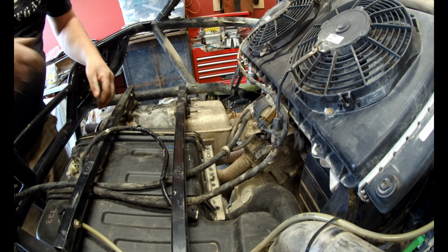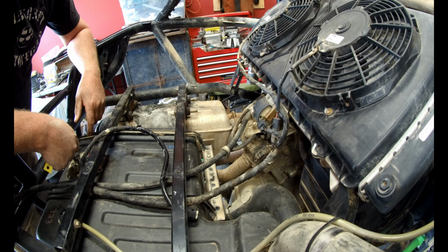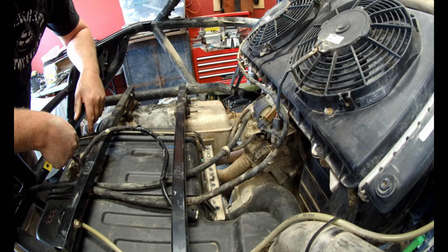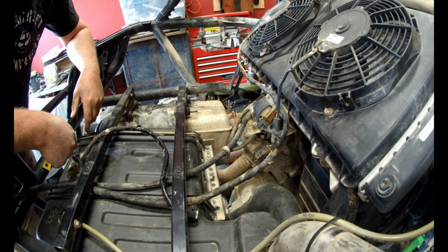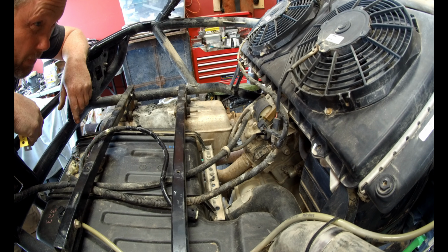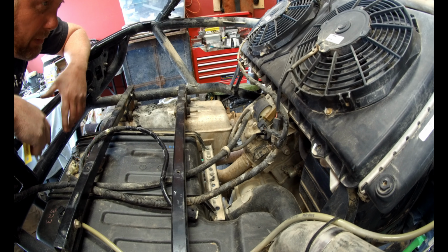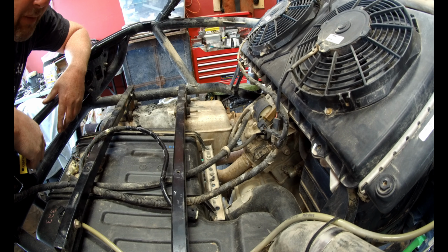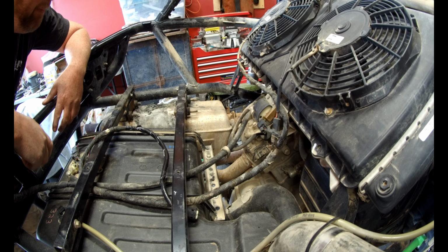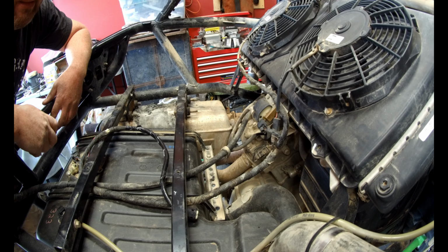Yeah, I can't get it to idle. I have to keep my foot on the throttle to keep it going. It sort of smooths out a bit more around 2,500 RPM to 3,000. But it's definitely kind of like it's missing, so I'm not too sure why it's missing. Again, replaced the spark plugs already, so I'll just have to do a bit of research on that and see what we can come up with. Hopefully not a big problem. We will see.